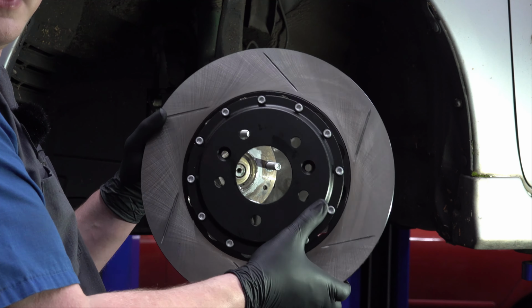So we went slightly out of sequence with the brake steps here, the installation instructions versus what Corksport recommends. So these are almost certainly going to fall off, explode, and kill everybody on the planet now. But what they recommend doing before putting the rotor on is to put the caliper mounting bracket on, which I probably should have done, because then you could actually see it, but whatever, YOLO. So we're going to do it this way instead.